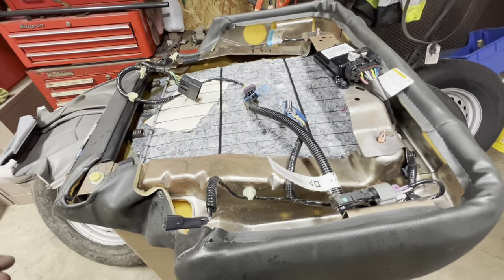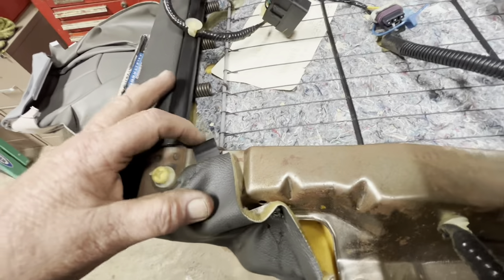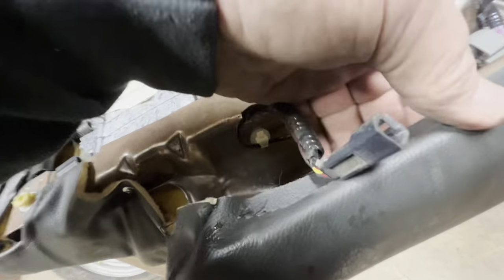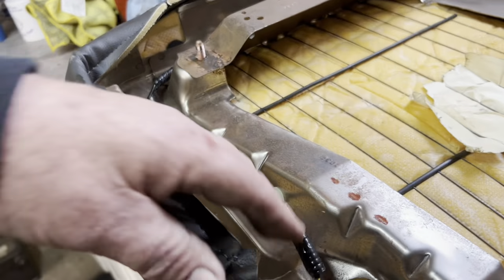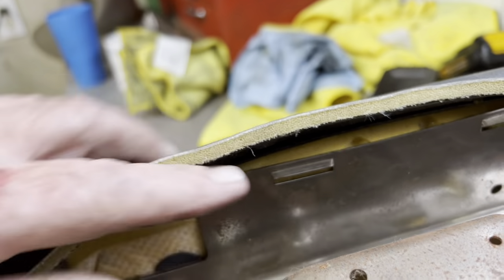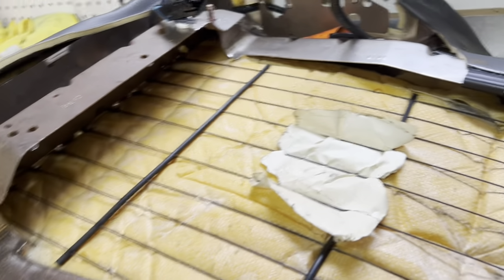On the underside of the seat you'll see the connectors. You could unplug it there, but I found it easier the other way. You'll see a tab right here — peel that back, and the same on this side. There are a couple of screws, one on each side, then there are little rails that slip on and one in the front. The cover just kind of rolls up off of there. There's a trim piece in the middle that holds it, and the same way in the front — it just rolls up off. These down here hold it down, and then there's one in the back that rolls up too.